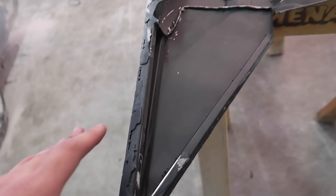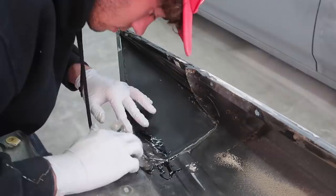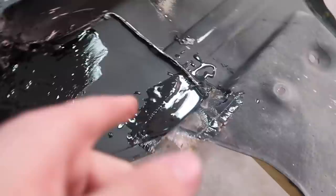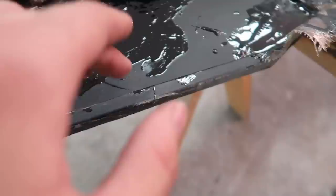I'm not going to spend too much time on it. It doesn't need to look perfect — I just want it to look a little bit more finished than it does now. And then once we do that we can start finishing off this edge, and you can see it is pretty bad. I only have one layer here so I'm going to wait till that one dries before I put another couple of layers. Here I don't think we're going to be putting anything else besides bondo glass and bondo just to finish that off.